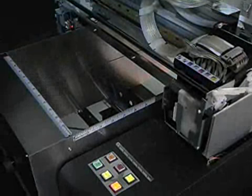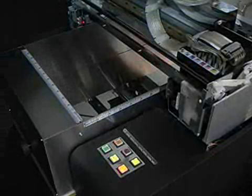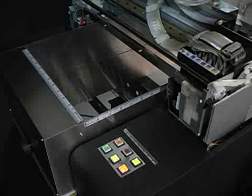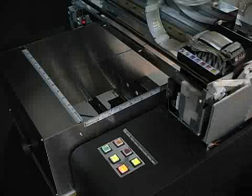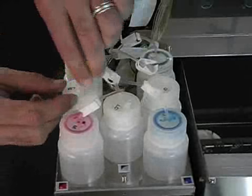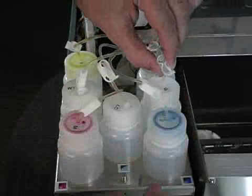When you've done your last cleaning cycle, the printhead and the whole system is now completely flushed and purged of ink, but we want to keep this solution in the printer. If the printer is going to sit idle for any length of time, this is the best way to keep the printer in hibernation mode and prevent any clogging. These jets are very small and it's very easy for them to clog. Without touching the ink fill button, go ahead and close the clips so there's no chance the solution can back-flow into the bottles. After that, you can turn the printer off, unplug it, and leave it to rest.